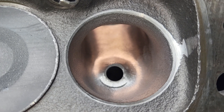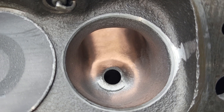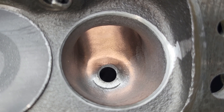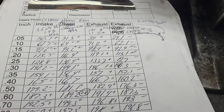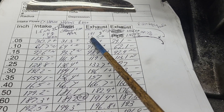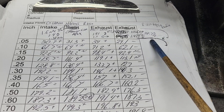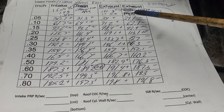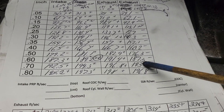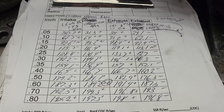I'm sure somebody knows way more about valve jobs and bowl ratios than me and they can explain it better. But as of right now, this is a loser. So let's take a look at it. Okay, this was the last one we did: 87.8%, 1.41, 1.4. Made them both a little bit bigger. It only averages out to 88.7%, unless I goofed up my math. How did we do as far as flow? Low everywhere. It's a loser everywhere.